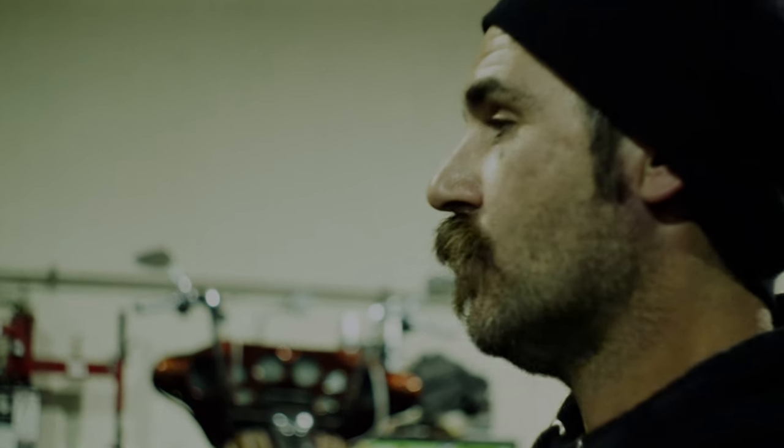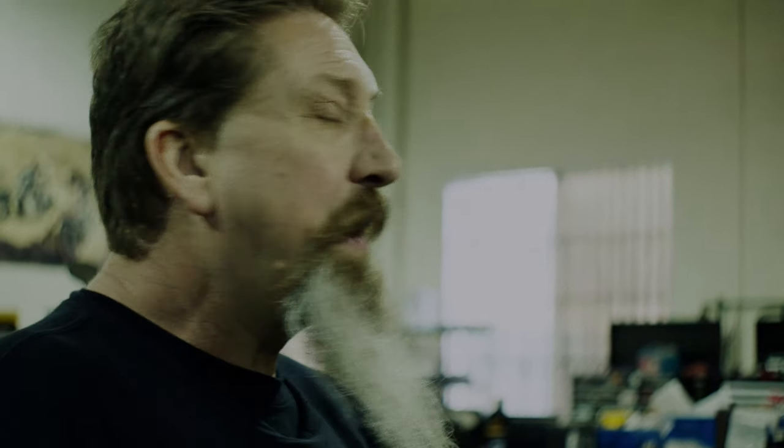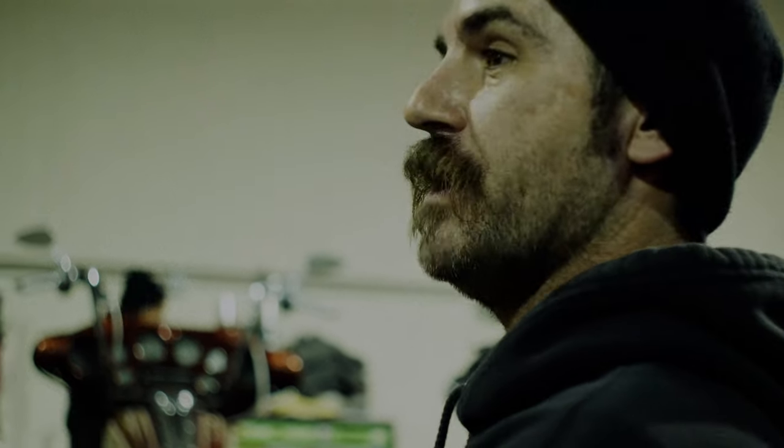Should I change my style to accommodate 14 and 14 — will that pull me out of the corner faster? That's a question for Jason Pridmore. Well, looks like I'm going to go talk to Jason today. Your bike's dialed in — dyno test it against the old shocks to get right in that range, which should put us in the middle of the valving on the shock. With the softer spring, under power just be sure the bike is dead stable — if it is, the spring's doing its job. It's going to be a little more plush, to help blow through compression and be more supple through the bumps and ridges. We'll supple it up next week anyway when we do the valving, and after that there's nothing more to do except go faster and faster.